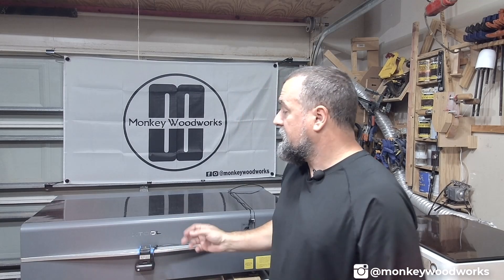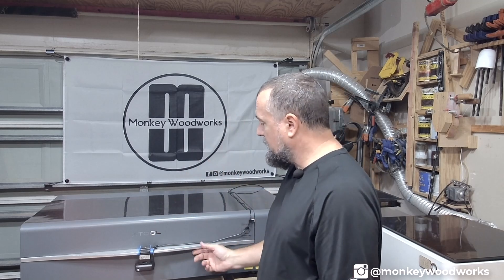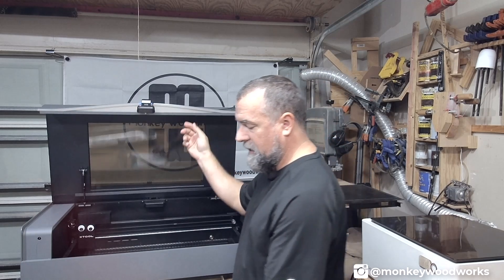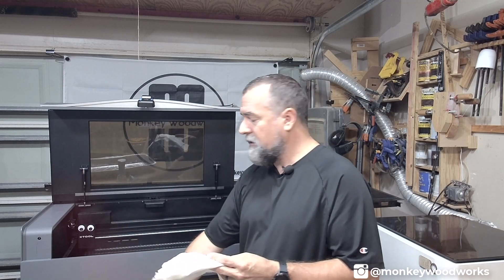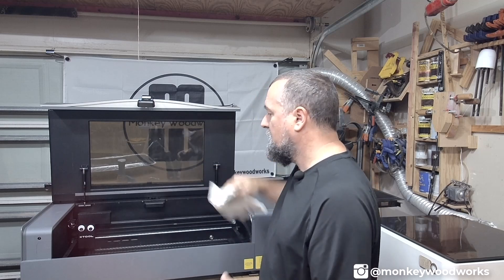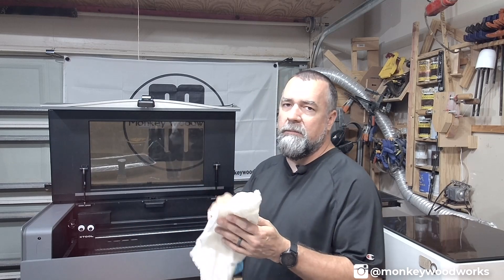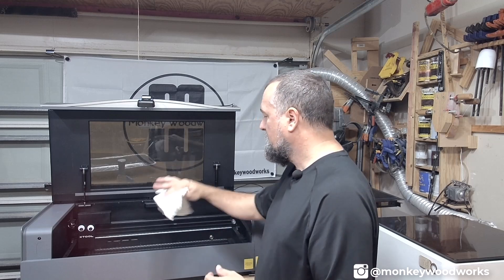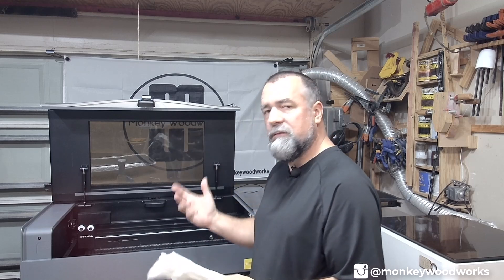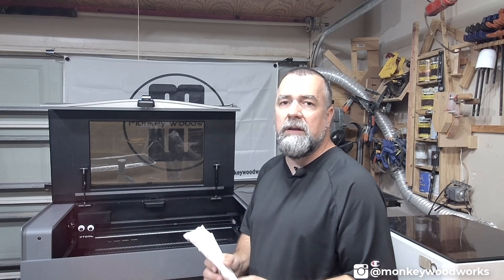So the first step in cleaning is the physical cleaning on the outside. You'll wipe it all down, open it up. Take some isopropyl alcohol and put it on a rag and wipe everything down. I suggest spraying on the paper rather than spraying directly in the unit, just in case — I don't want to damage anything inside my P2. If you have a small vacuum, you can use that to vacuum out some corners, but just make sure it's all clean to the touch.